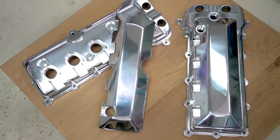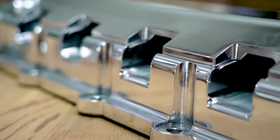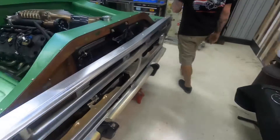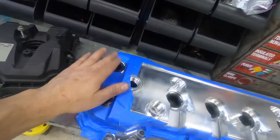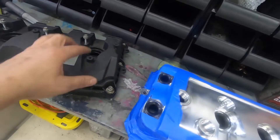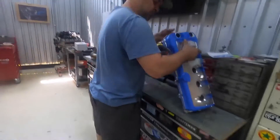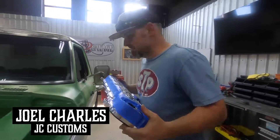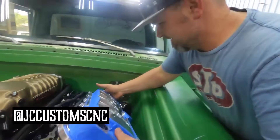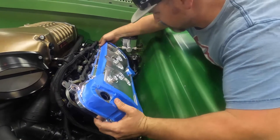These are billet valve covers, handmade by JC Customs locally here in South Florida. These are going to freshen up this engine bay and take it to a whole other level. We have our driver's side all prepped. If you ever order a set from JC, get new O-rings — you can get them from Ford, no problem. The old ones in the plastic are really hard and brittle. The billet hold-downs stand off so you don't over-tighten against the gasket — they stick out the bottom about 50 thousandths and just stop.